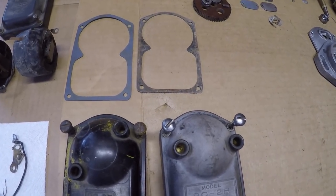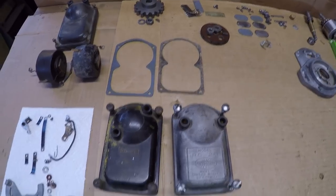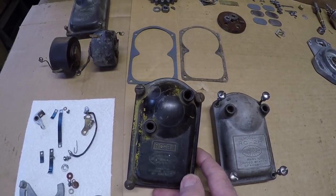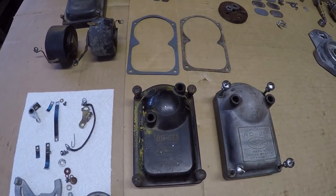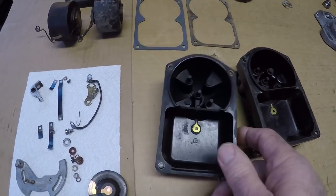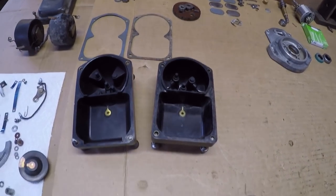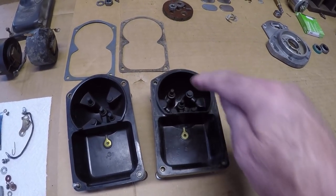I do have an old gasket that is still serviceable. You'll find about 75% of these when you take them apart don't have that gasket in the cap. Here are the caps — this is the original one off that mag. You'll notice the plug terminals are across from each other. This is another RC2H where the plug terminals are at an angle on the cap. Either cap will work on this mag. The way to tell is you've got to look at the inside — your pickups are exactly the same place. It's just on the inside part of the mag where it directs the current. This is a 180-degree opposed configuration, so you'll have them across from each other.